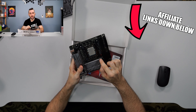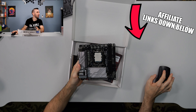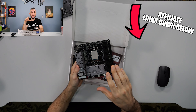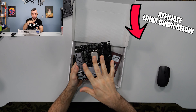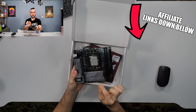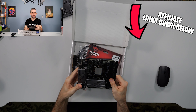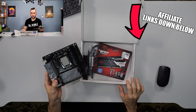I would not put an i9 on this thing. You can literally see there are no VRM heatsinks on this motherboard. It works very well in an H1 case, which is what we're going to use, because the H1 CPU fan blows directly on the motherboard. I wouldn't use this in a normal ITX case without serious airflow — it will throttle a stock i9, no problem.